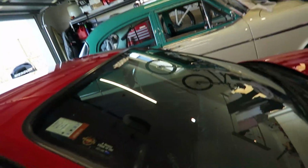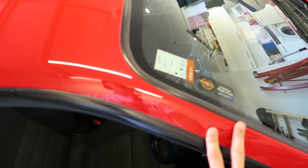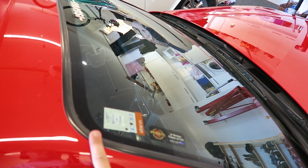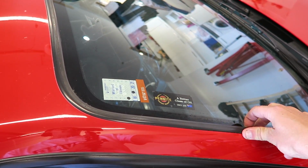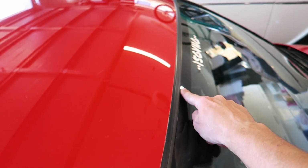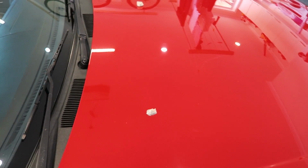Now first of all, when you're doing any cutting and polishing, you're going to want to tape off any sort of rubber or anything on your car, because I'm not sure if you're going to be using the exact polishing products that I use, but I'm only safe to assume that you won't be. Mine are water-based, so they won't actually stain this, but if you're not using a water-based product, they can stain this. So it's easier just to get masking tape, kind of run it all the way along and around. I've done it here on the bonnet with some of my window washers.